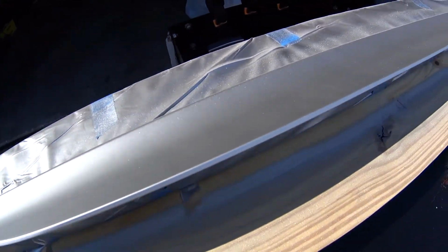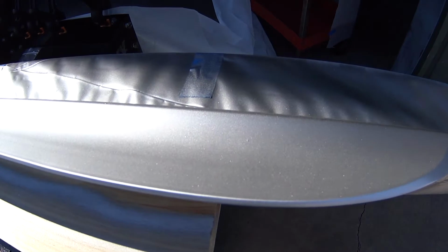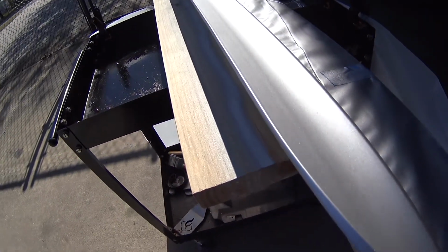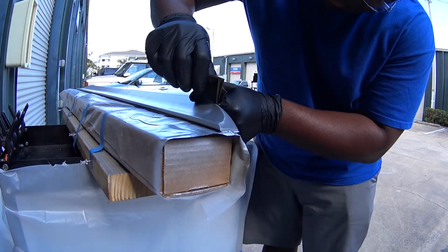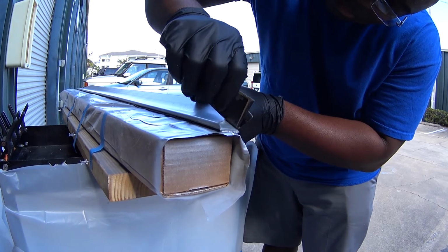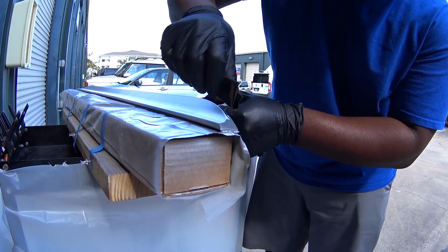But an outdoor paint job wouldn't be proper without an occasional dirt nib or two, or three. So this calls for some wet sanding on the base coat followed by some touch-up before the clear is laid on. I'm wet sanding with 1000 grit sandpaper as the dirt nibs are relatively small, but you can still see them. Sanding with 1000 grit ensures that too much base coat won't be rubbed away during the smoothing process.